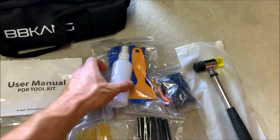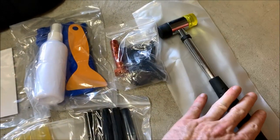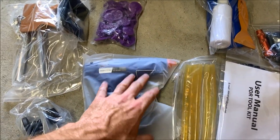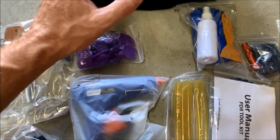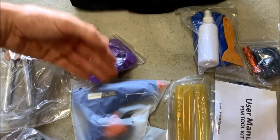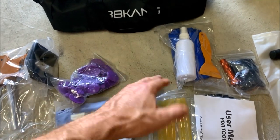There's a little scrape tool to scrape some of the glue off, and then you have this knockdown tool with all these different sizes and shapes of inserts, and a little hammer to use with it. I'm going to use the tabs first — I'll heat the glue sticks in the glue gun, put it on the correct size tab for the dent, put the tab on the dent, hook this thing up and try to pop it out. Once it's out far enough, I'll use the knockdown tool and hammer to flatten out the edges.